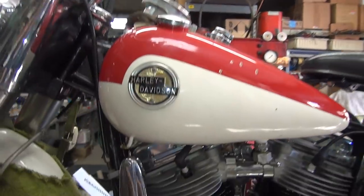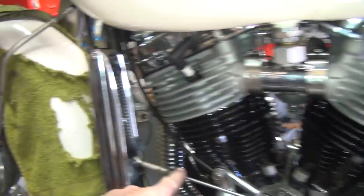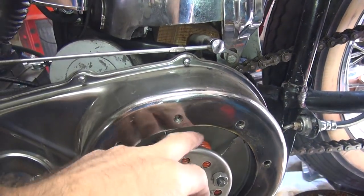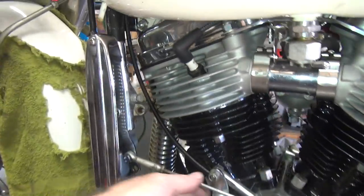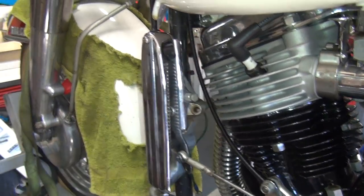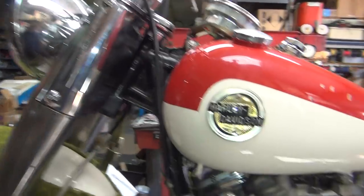We cannot have free play in this thing. Let's see if that will work now - it's a little bit dry in there. So we only got this much free play right here. When you pull the clutch in, see how it just doesn't want to come back - you need some lubricant on these parts. It feels gummy. So everything needs to get lubricated - the cable all through here, all the pivot points. Once it frees up and pops back like it's supposed to, you can probably give it a little bit more free play here. If this is tight down here, you're going to burn the clutch up because it's not going to be fully locked up.